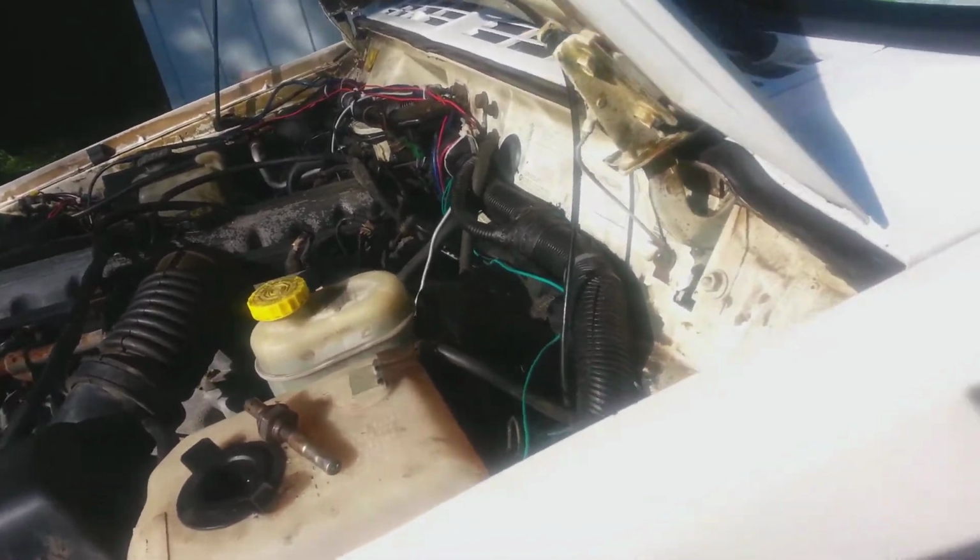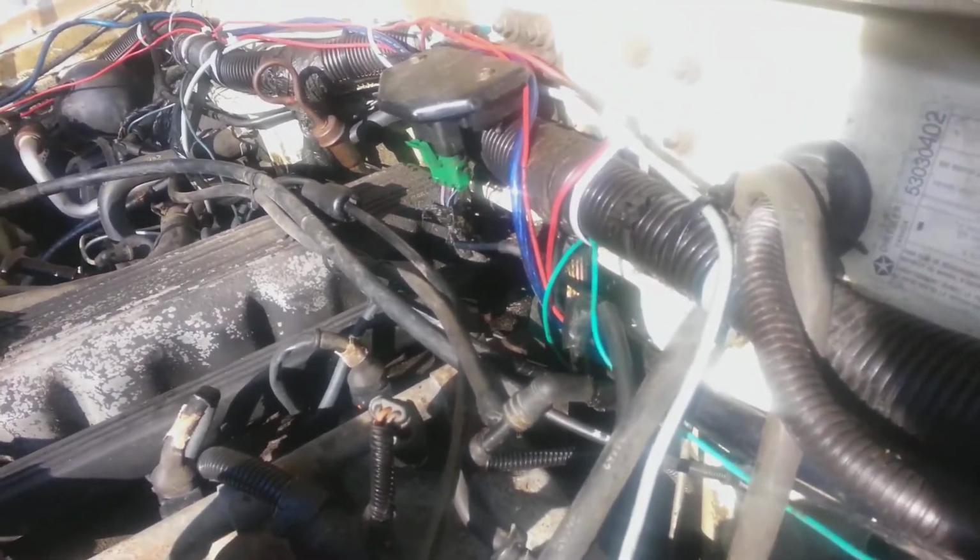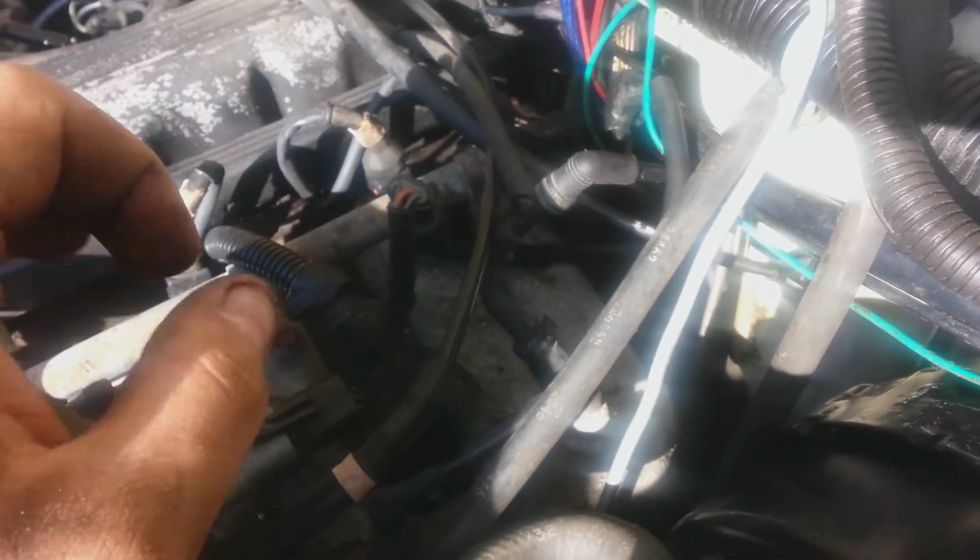I think Jacob's arms are long and skinny enough to get up in there to start threading the bolts for me, so that's a big plus. Alright, so got crankshaft position sensor in. Holy fuck. Talk about turning into a fucking octopus there to try and place things, eh? That's horrible. It's not a super hard job, it's just really hard to get up in there. It's just, you know, two bolts and then you gotta place it. But the best thing you can do is move over here from underneath and pass your hand on the backside of the engine and you can kind of get up there and place it and slowly start threading a bolt in.